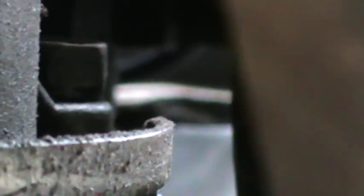We are now underneath the vehicle, and I'm going to show you where the starter is located. You come right to the front where the engine and transmission join in connection. And if you will look over here, you should see a cylinder. That is the starter. And there is a bolt right here, and then there is a bolt right there. That one will probably be a little hard to access, but I think we should be able to access that with not a big problem. Then the wire terminals on the far rear of the starter, so we will disconnect that here momentarily.